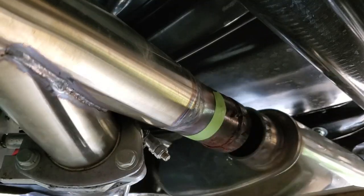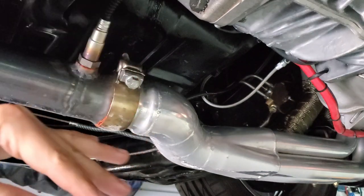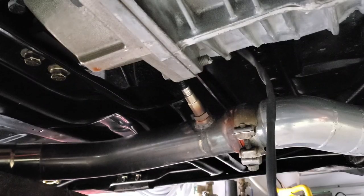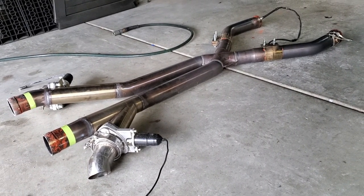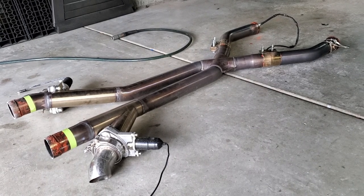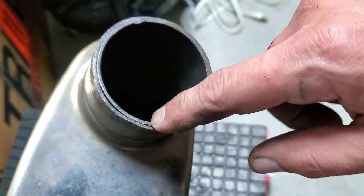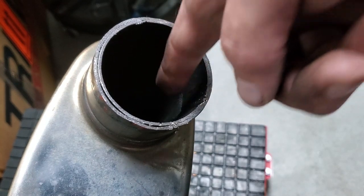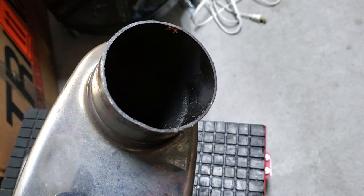That was easy — two done. I should be able to just loosen these front ball joint clamps and lower the rear of the pipes because they're not attached, and it should just pop right out. Just have to pull the exhaust cans out and mock them up on the workbench, then we can start trimming these ends to fit our four-inch dimension on the exhaust pipe. The pipe is actually inside the exhaust can, so this is two layers of pipe. What I did was take my reciprocating saw and slit the inside, and then this just slides right out.